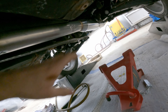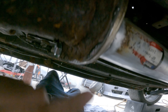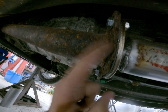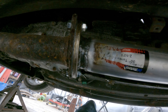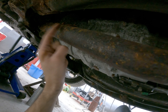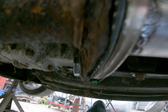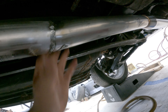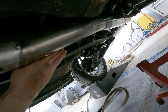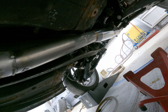Under the car, everything's in — bolt it up. And I'm calling it now: this is not going to seal. It's so rotten — it's unreal. So I'm probably going to have to cut this flange off, cut this back, and redo this section. For now, we're just going to start it and see what it sounds like. I'm sure it's going to be leaking from right there. I'm not a professional welder, obviously, but if you have a welder and you've got a couple hundred bucks, you can definitely do this in a weekend — or even a day if you're really trying — and save yourself like five hundred bucks.